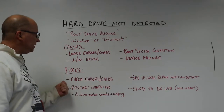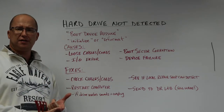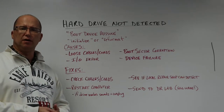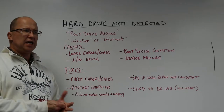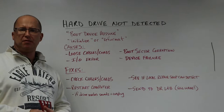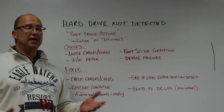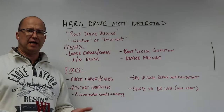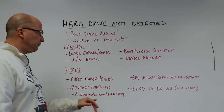Some of the fixes: first and foremost, check all your cabling. If you know your SATA connection is snug, try another SATA connector, try another cord. Same with a USB device or external device — if you're sure everything's good and snug, try a different USB cord. They're usually very easy to find, and sometimes those cords go bad. Maybe they got pinched somewhere or have a nick in them you don't see. Just replacing that cord could fix the issue.